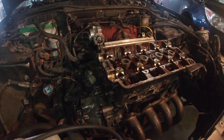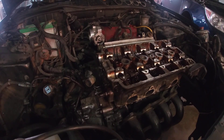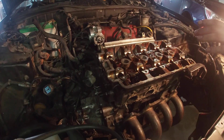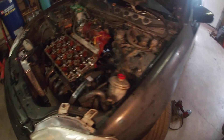That's the same idea for K series, B series, H series, D series, J series, whatever you want to call it - LS - just make sure you guys find the proper torque sequence and that's how you do it. I'm going to get everything clean, prepped, oiled up all across so I can set the cams back in and get everything tightened down - I'll show you how to do that too. You can see the new water pump here - I put a new water pump, new tensioner, blocks all cleaned, everything sealed up real nice. This guy's going to be really excited to get this thing back out and I can't wait to try it, to tell you the truth. Just getting back in the old Honda game - it's been a long winter here in Canada. Outside you can actually see the driveway now, so we're going to get this lubed up and I'll be right back boys.